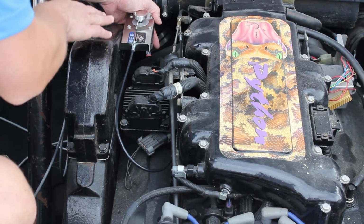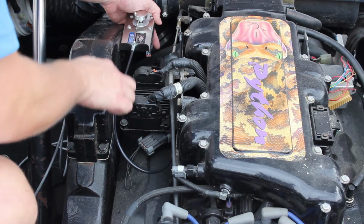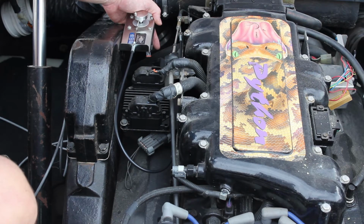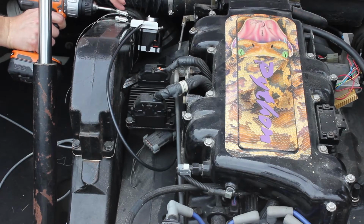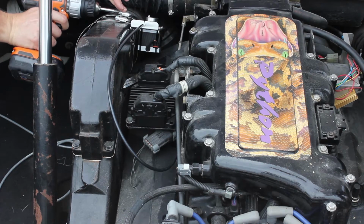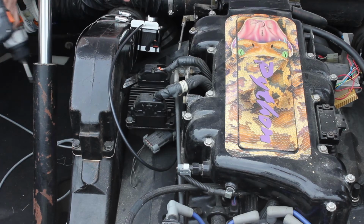For the throttle motor, the key is to find a location that you can mount it where the control cable will have a smooth bend to where it connects to the throttle arm on the engine. Often the throttle motor can be mounted on the exhaust hose connected to the riser. On this engine, the best location where there were no clearance issues with other parts and allowed a smooth bend in the control cable was on the riser itself.